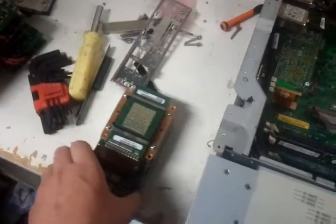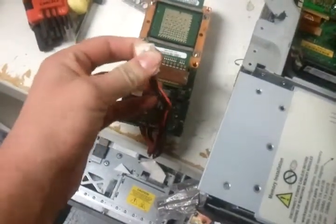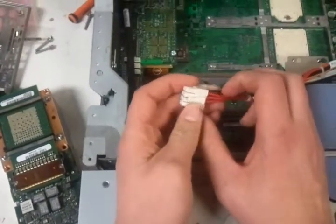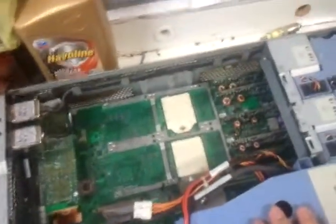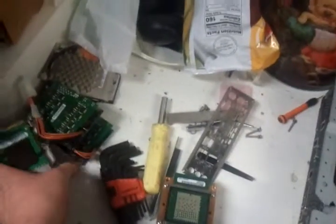I initially wanted to go with two dual-core 1.4 gigahertz processors, but the pinout is wrong — the red wires are on the bottom and black on top, compared to what you'd normally click into. I powered this up with both installed and it gave me a voltage error for the microprocessors. I looked in and realized the wiring's wrong. I tried to adapt the pins but had no luck getting them out, so I said screw it and ordered a set of 1.6.